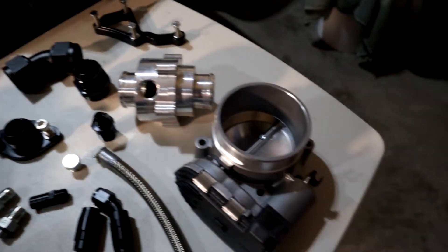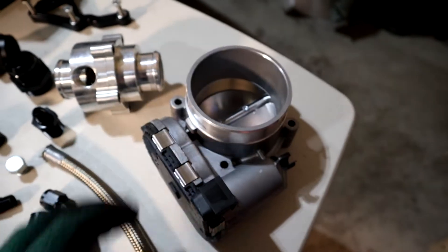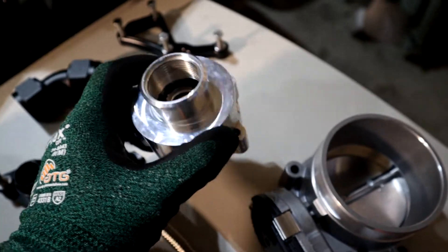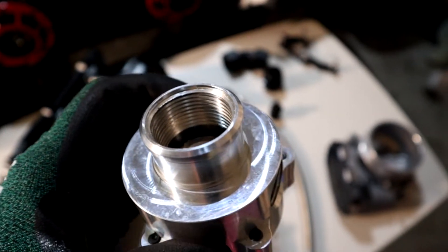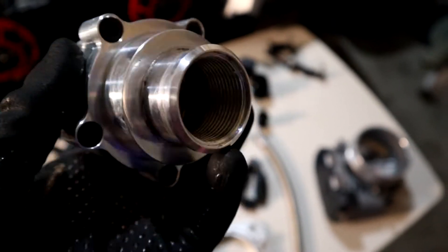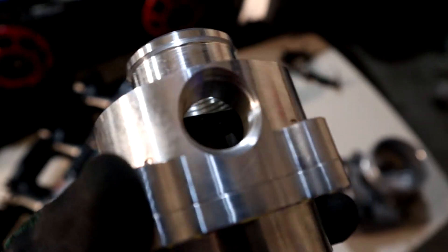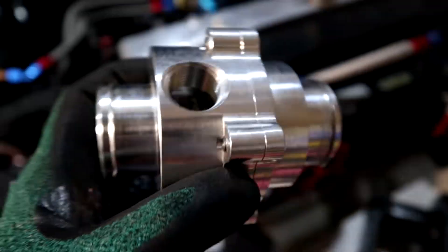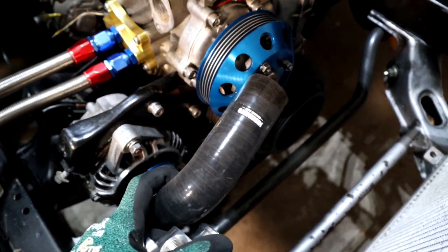The other parts: we've got the actual Bosch 80 millimeter throttle body — I'll link where I found everything in the description. We've also got an inline thermostat. Inside the threaded holes it's Dash-16 on both sides, the outer diameter is one and a half inches, and the coolant bypass is half-inch NPT. You can see the actual thermostat inside. This is going to be mounted down in the engine bay, coming off of this large hose.